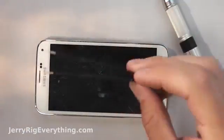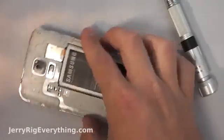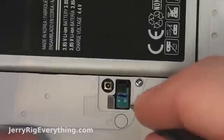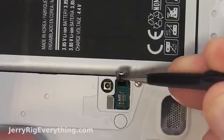I am using some playing cards, a screwdriver, and some tweezers to finish this repair. I'm going to pop off the back cover of the phone, and then underneath this little plastic piece right here there's a little ribbon cable that we're going to disconnect. This ribbon cable goes to the home button on the Galaxy S5.